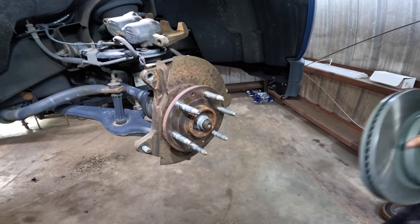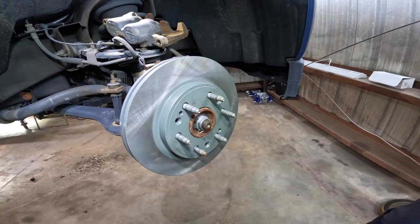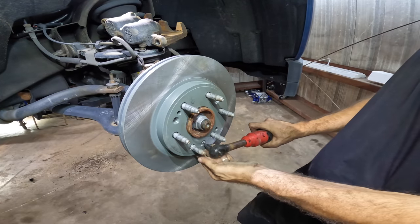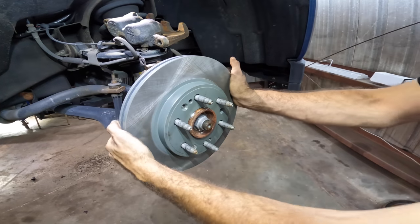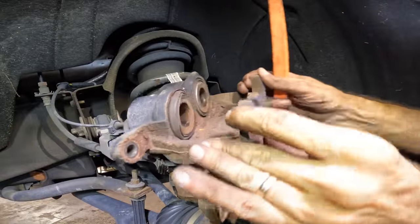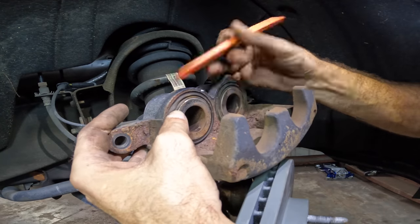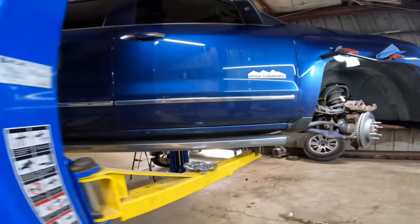All right, rotor coming in. Right about, that's good. Set screw. Kickage. Very nice. All right. And one more caliper to compress. Uh-oh. We have a caliper boot that's sticking out. Let's put that back. You go back where you go. Beautiful. Okay, one more corner to disassemble, and we'll put it all back together.